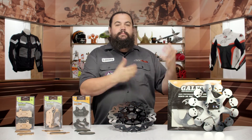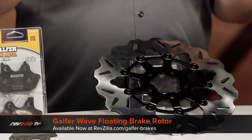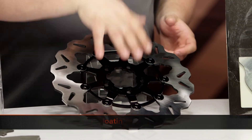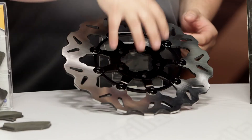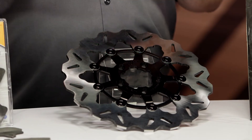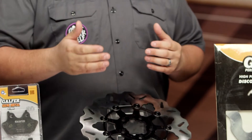Moving on down the line, when we look at this half of the table, you can see we've got a couple of brake rotors here. Going back to Galfer's sport bike heritage, the first thing we've got up here is a full floater rotor. Harley-Davidson themselves have started putting full floater rotors on bikes, but not all of them. If you have a bike and you're looking to upgrade the brake system and you don't have a fully floating rotor, this is what you're going to want to look at. A fully floating rotor is basically a two-piece rotor — you've got the outer braking surface connected to an inner carrier, and those parts can move slightly independently of each other. It allows for heat expansion, so if you're riding the bike really hard, you're not going to get weird brake activity. It also allows for a little bit of lateral movement, so it can provide better feel at the lever or the pedal, depending on where that brake is installed.